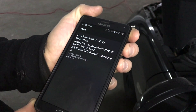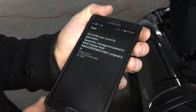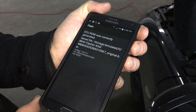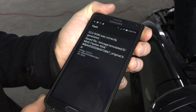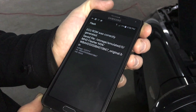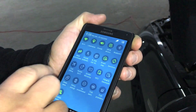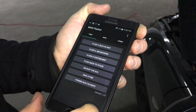Okay, we've successfully purchased both the flasher and Stage 1 maps. Then we went for backup of the ECU ROM. Now keep all possible fingers crossed, because we are going back to the main screen and we'll hit flash. Very important thing — airplane mode on.